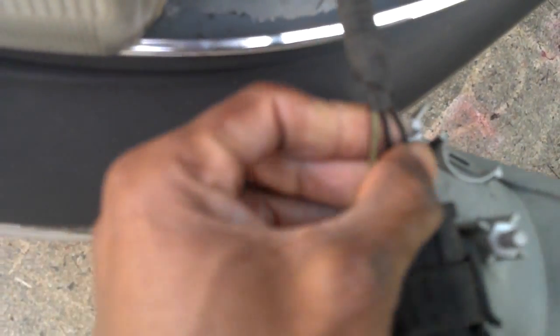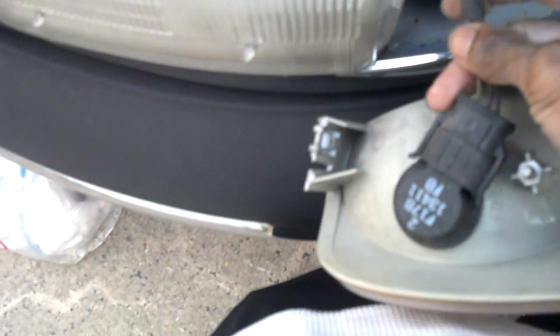Okay, here we are with the parking light out. The one plug in there, just take the plug. You see there are 3 wires here. I have 2 black wires and a green wire. I'm actually going to have to play with the wires to see which ones keep our light on. But you just pretty much tap into these 3 wires, and then run your wire back out the same hole that's here, back into the hole, down into the front of the grill. You might want to solder these in place, use some connectors, tape everything back up. Pretty simple process.